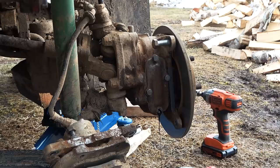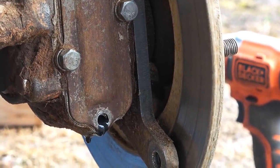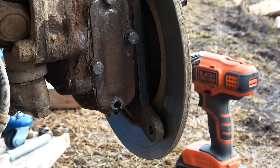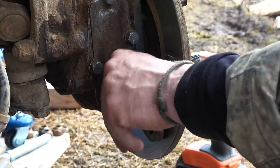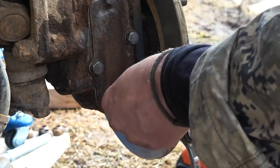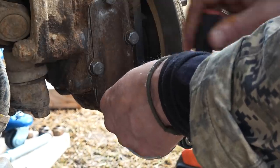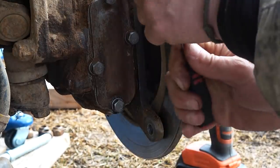It's a very thick, modern old-school mineral oil. As you can see, it's only dripping now. So we're going to install the drain plug again and then remove the top one here. I could run some diesel through this little portal hub here, but I don't really see any big need for that.